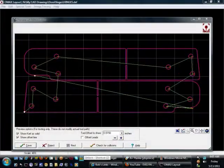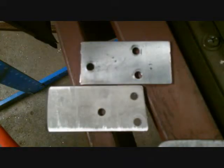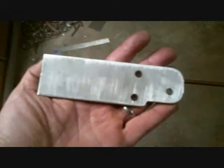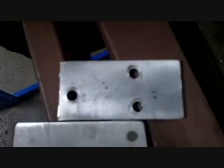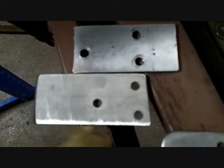This is the lower hinge on the driver's side. I trimmed off the tab that was bent — that I had cut and bent with the bandsaw earlier — because this one has to be an inch and three-eighths longer. I made something like this. This is an original. If you notice, the hole between here and here is pretty distant. These two are a little closer because this is a copy of the one that goes on the doorpost. The hole that was here was kind of off the edge of the plate almost.